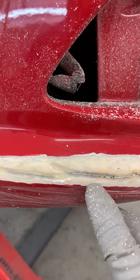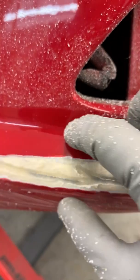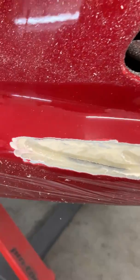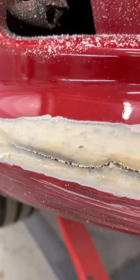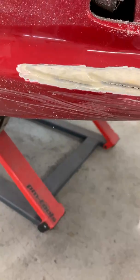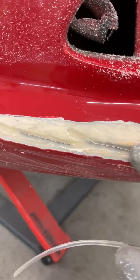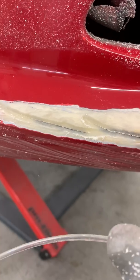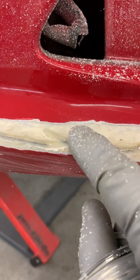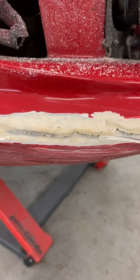I've removed all of the previous repairer's filler and cold welding two-pack glue. I'm going to sand this area now with some P80 or P60 just to widen this up. You can see I've grooved out all the way along the crack, because when I weld the ribbon in, I'm actually just melting it in there so it acts like a hot glue bonding the two sides together. It will not, unlike conventional polypropylene or ABS, actually fuse the existing panel — you cannot re-heat this and re-weld it. We're just going to fill that in with the new rod, let it cool down, and sand it.